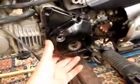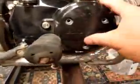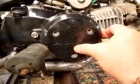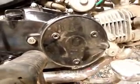I nearly got caught out there. In the Haynes manual it's talking about removing the clutch cover and it's showing this cover on this side. So one naturally assumes that it's this cover on this side. I'd loosened it, but then I went and rechecked again, mainly because I couldn't get past a connector in there for the wire going to the alternator. And the clutch is on the other side! So don't get caught out like that. There's also this cover here which says Honda — I thought maybe we can get to the clutch through there. I took that off and lo and behold there's nothing there — it's just blank. So that's a waste of time, don't bother doing that.